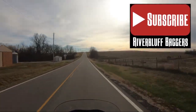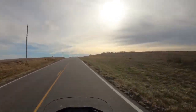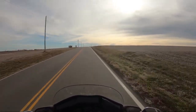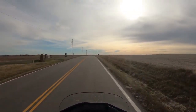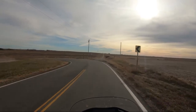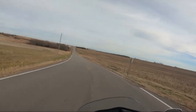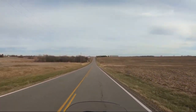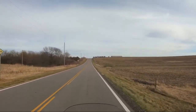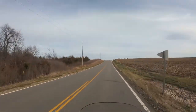That being said, the next thing with cold weather is it's going to be a little harder on your battery. So we recommend a battery tender to keep it strong and at as high a voltage as you can keep it. That way, if you don't get to ride it all week long and you want to go out and take a short trip on the weekend, your battery is not dead. So keep a battery tender on it. If you're one of the guys that puts your bike away for the whole winter, then I recommend that you take the battery out of the bike and take it inside where it's nice and warm, in a warm place in your house or a warm garage. Take it off the bike though. Unhook it completely. So, that would be my tip number 2.